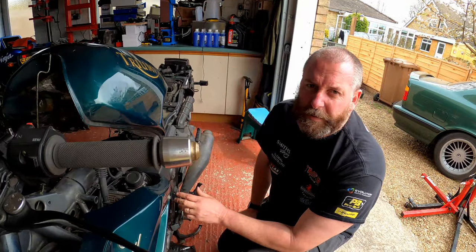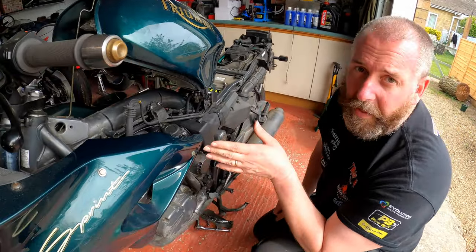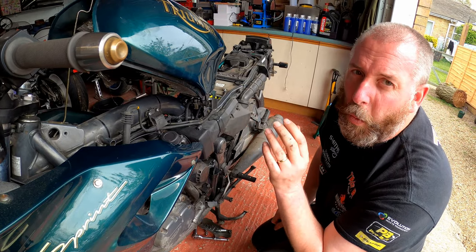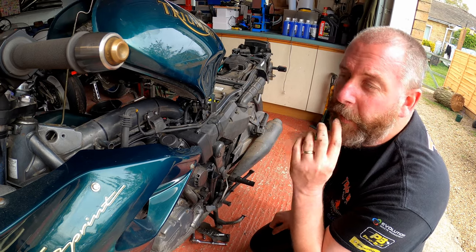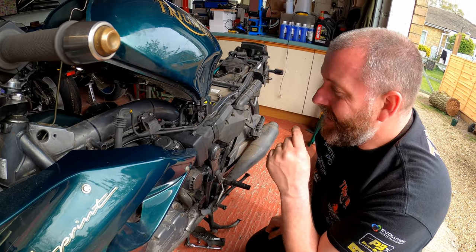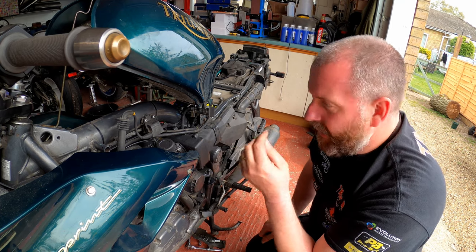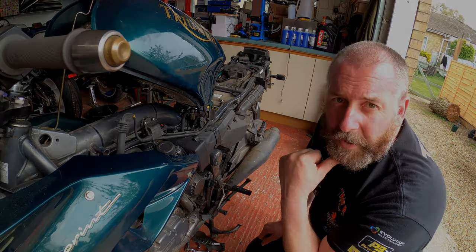Okay, so I've made some little adjustments — I didn't tweak it much, but I'm a bit more happy with the color we've got there. I'm not sure how well it was showing up on camera, but it was more on the white side as opposed to Bunsen blue. So I made a little adjustment and it seems to be a better color now. What I need to do is move on to cylinders two and three and carry out the same process. I'll get them done and bring you back at the end to discuss what we've done.